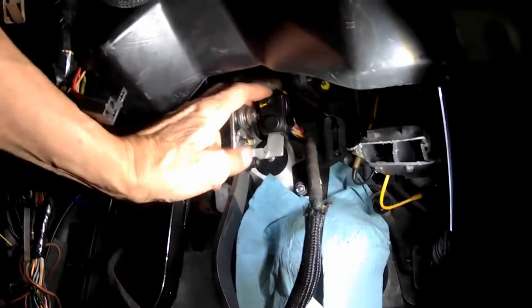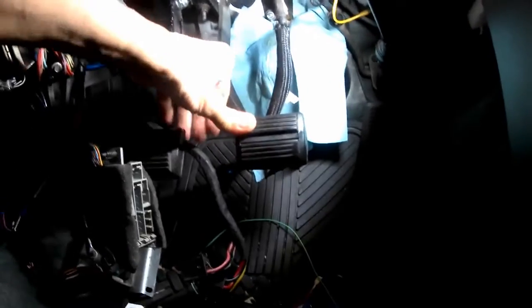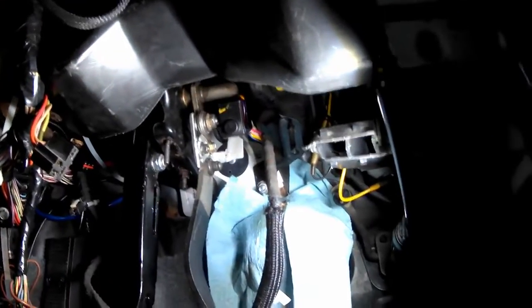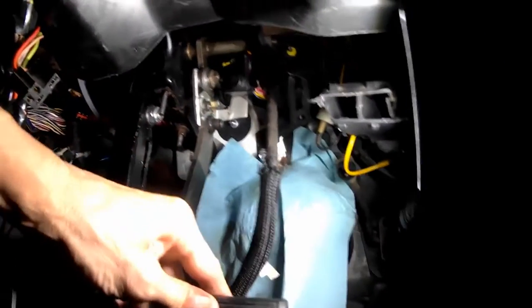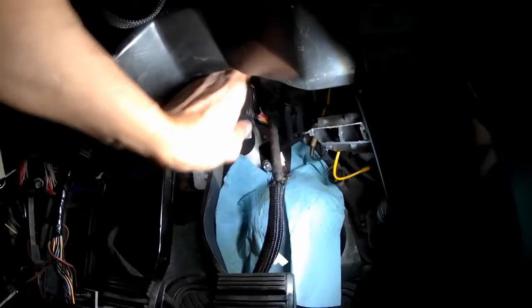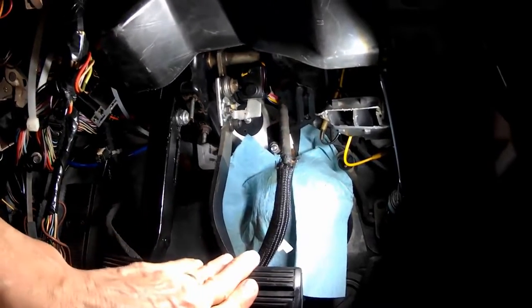If you want to adjust your brake light switch so that the lights come on when the pedal's in the right position: right now the pedal's up, but if you wanted it to be further out, all you have to do is push the switch in. It's actually on a slide — it's kind of loosely clipped in there. When you bring your brake pedal back, wherever it stops, that's where that switch will be. If you pull your pedal further back, the switch itself will actually pull back. As soon as you press your brake pedal, you get a brake light.